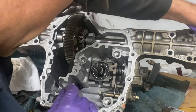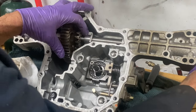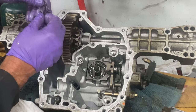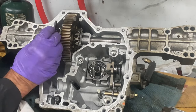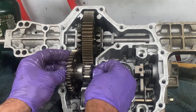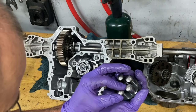I'm going to pull this out until I see the first groove, which is right there. There are wear marks on this side, so this side goes on this side. Pull the side so you see a groove, then push it in. This gear here is indented inside, so it goes on this side — the shorter axle. This one's full, this one's half; half goes on the inside. I'll clean them all — they're all good, there's no play in these.